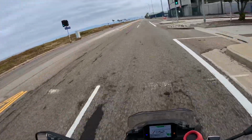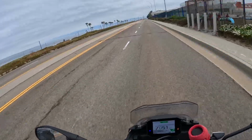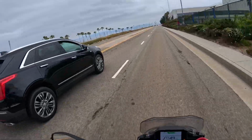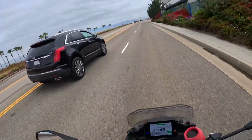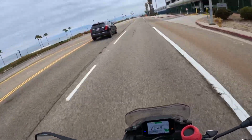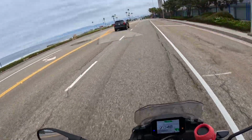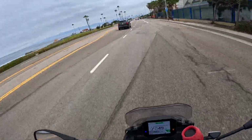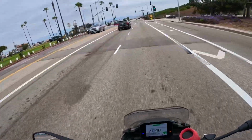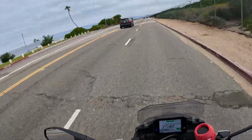The reason why I wanted to do this video is because most people who have the tune have an aftermarket exhaust. But the really nice thing about the T800 is that you can do basically anything you want. You can have different levels of the exhaust. There's one that I'm using that's for the stock exhaust. Then there's one if you have just an aftermarket exhaust slip-on. Then there's one if you do a full exhaust system swap, and you do the air box and you delete the cat and all the other stuff. But I just have it with the stock OEM exhaust.